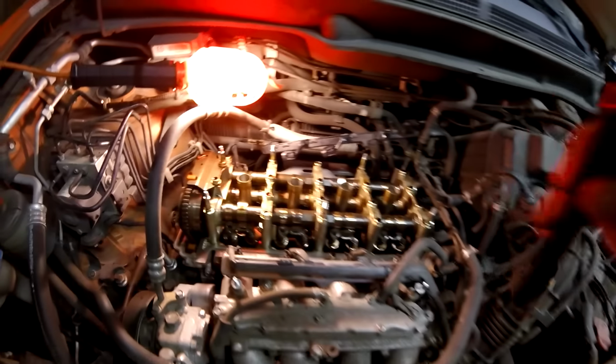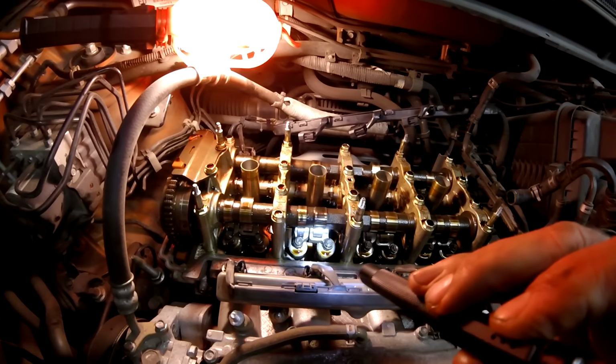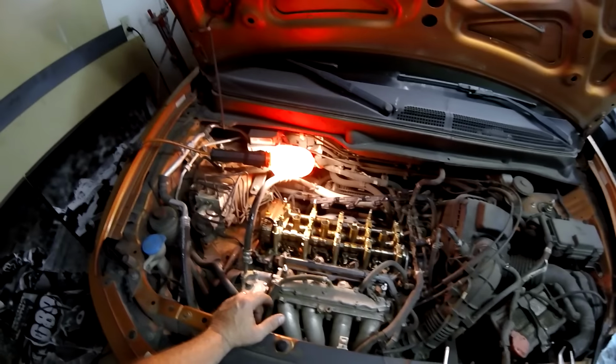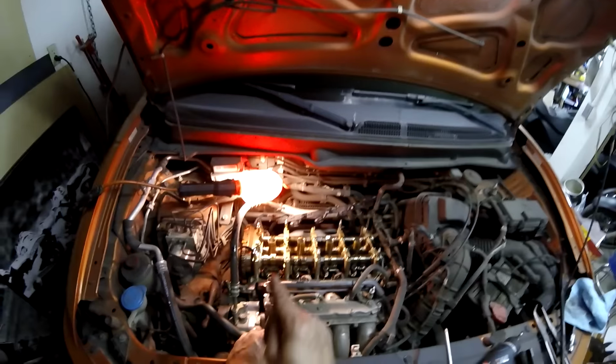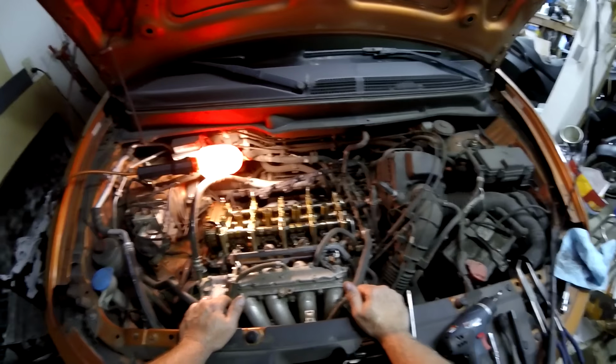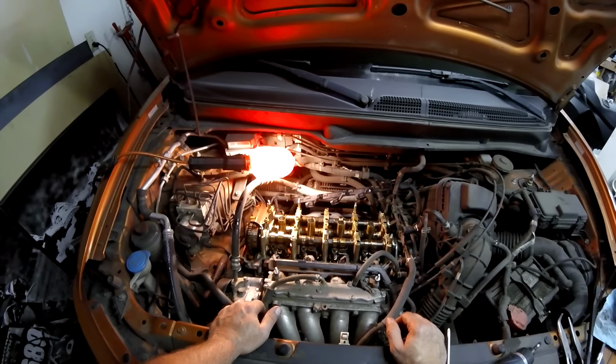But as you can see, it's tappet lock nut style adjusters. No shims, roller rockers. So my suspicions were correct. And yes, tight valves can trigger a misfire due to a stumbling of the engine. It absolutely will happen. All right, time for adjustment.